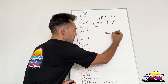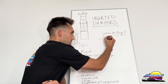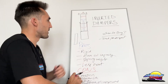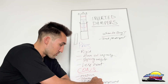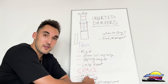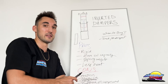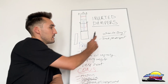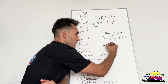So the question is: when should you buy them? Because of all these factors, they're really only useful for track or motorsport use. If you're going to the track, you have McPherson struts, you want the most performance out of your dampers, and you don't mind the extra servicing — the shorter life and more regular maintenance — then they're really good for track use. If you're doing regular track use or building a race car that's not going to see a lot of road use, you would want to buy these. That's literally what they're made for.